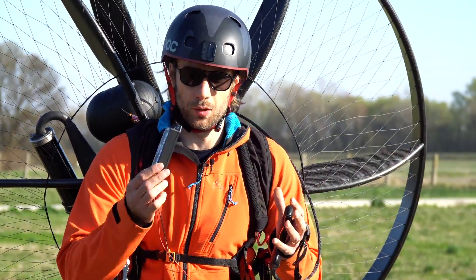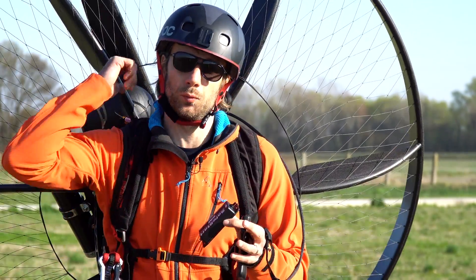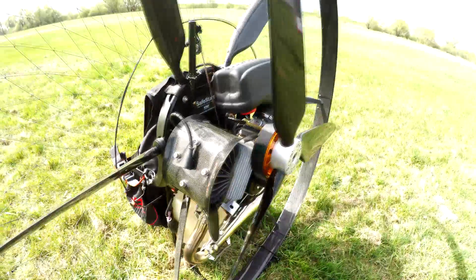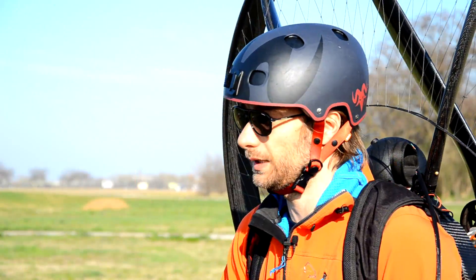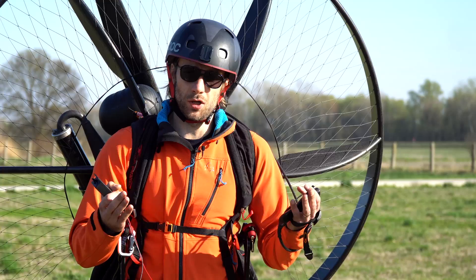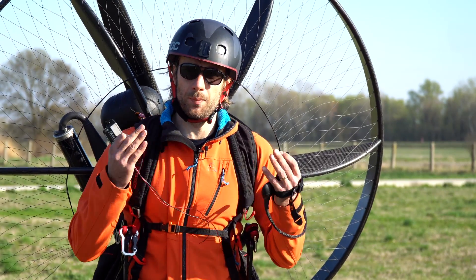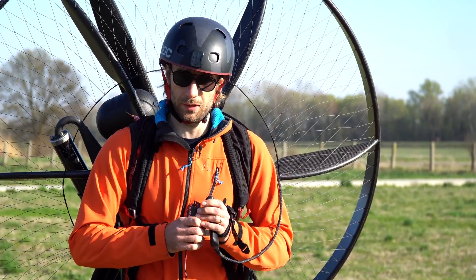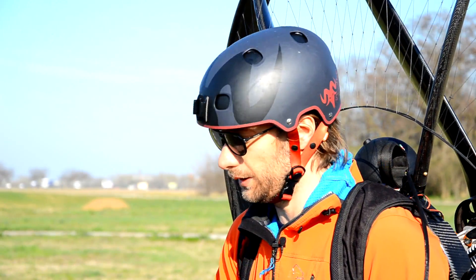In this video, I want to show how it works. It's a little computer inside and I have installed one on my back. The Safestar is constantly monitoring the RPM of the engine. And if the Safestar recognizes that the engine has been started and the RPM increases above 3200 within the first three seconds after start, it will immediately kill the engine.